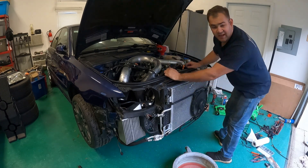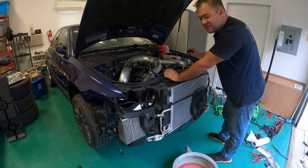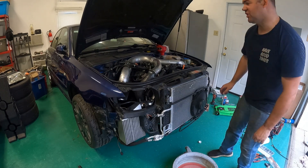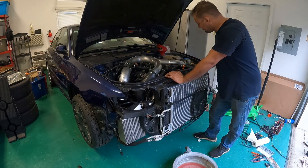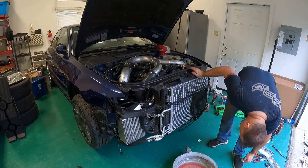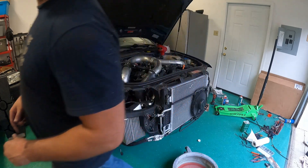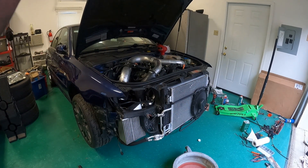I got a little hasty with the coolant, but we're going to let the system bleed down. I had to pull the overflow hose up here so it stopped draining out. Got a little smoke from the cooling system, but that's all I'm seeing so far. We have no other leaks — everything else is looking really tidy. I'm going to let it run for a little bit, warm up to temperature, and then we'll shut her down and take it out on the road.